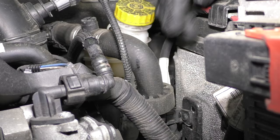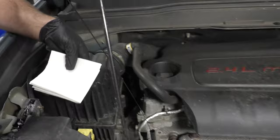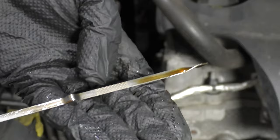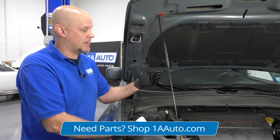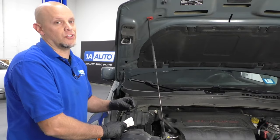Number three, oil consumption. A lot of vehicles have oil consumption problems, and what you need to do is check your oil regularly. Pull the dipstick out, you want to wipe it, reinsert the dipstick, and then check it. You want the oil between those hash marks. Now this vehicle is on the low side, so we would need to add a quart of oil at this point. A lot of this has to do with the piston rings — oil can get past the rings, and it will burn, and over time you're going to lose a little bit of oil. You want to check it regularly; it's a good idea to check it every thousand miles if you think you're having a problem. If you think you have this problem, the best thing to do is go to the dealer, have them start an oil consumption test, and go from there.